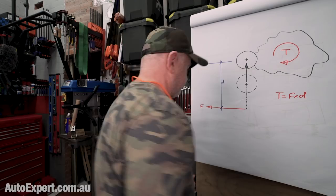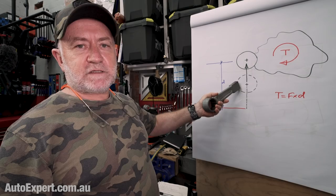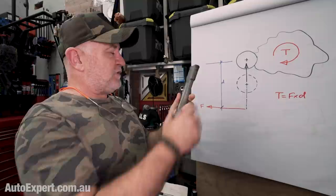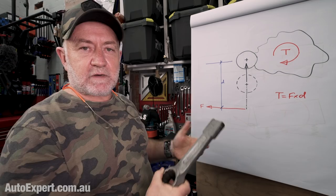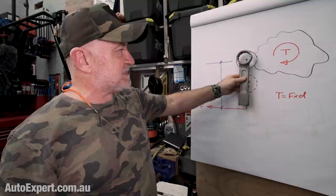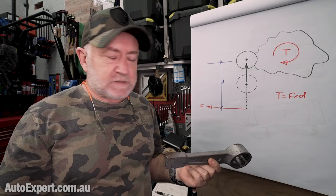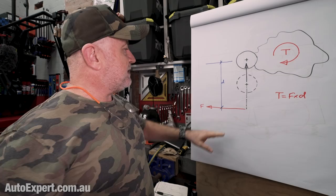What you want to do is think: here's our tow ball. Maybe we can just raise the tow ball up a little bit to give us a bit of arm on our spanner. If we had a spanner that was this long, now we can have a longer spanner and it'll give us more torque. The tow ball is rigidly attached to the vehicle. If we increase its elevation a little bit, it gives us a longer arm. A longer spanner equals more torque, and then we've got to figure out a way to put some force on it.